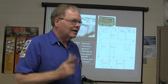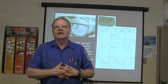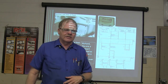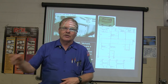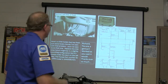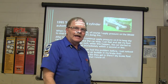Silver bullets are rare — you don't usually have one for anybody. One time a lady called me about a Ford Explorer. She said sometimes when she goes to start it, it's really hard to start and acts up, sometimes idles rough. I walked out and said, 'You see that idle air control right there? Have your son take those two bolts out, go buy one of those, put it in there, and you'll be in fat city.' She put one on and that fixed it. At one dealership I was doing all the driveability work — 12 to 15 cars a day — I didn't even have time to sell a tune-up.